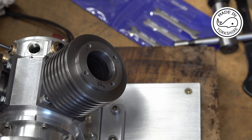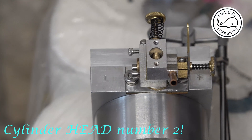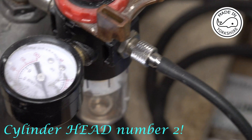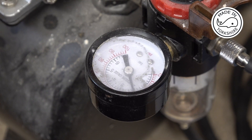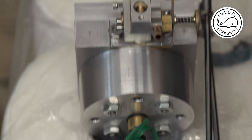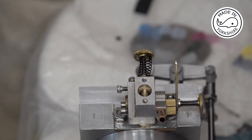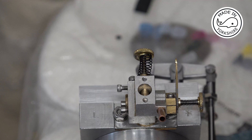So what I'll do is put this head back on and take the other one off just to do a bit of a sanity check on that as well. This is cylinder number two under compression and it's holding its own at 30 PSI. However, if I put my tongue against the exhaust inlet I can just feel a small amount of air coming out — very small amount. So I'm going to lap that valve seat and see if I can improve the situation.